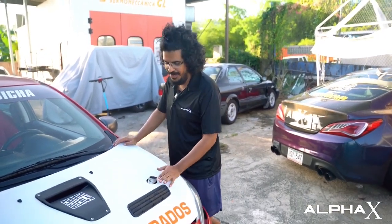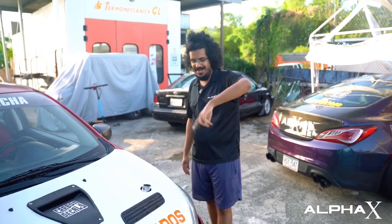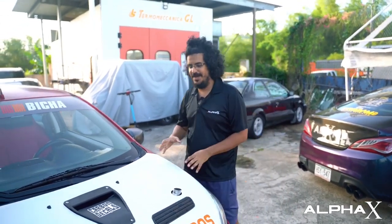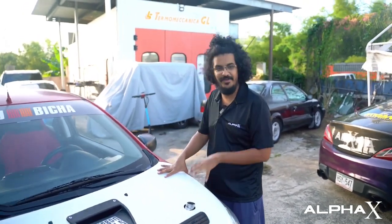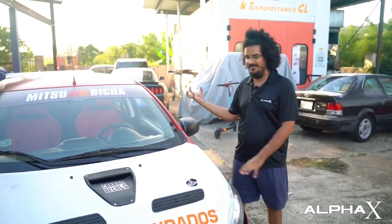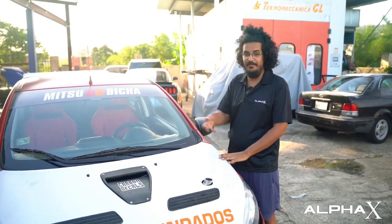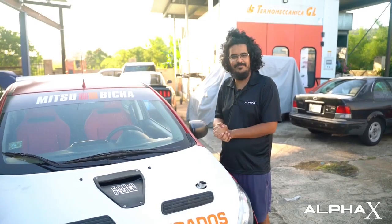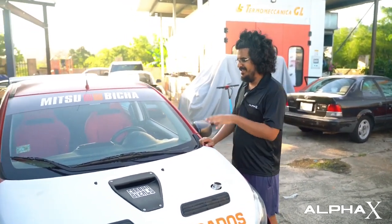Since we never found an aftermarket clutch solution, I did something I saw on a YouTube video about some guy who used a three-cylinder Mirage in his buggy — his name is DirtgearTV, I'll put a link in the description. We basically did a double diaphragm install. I bought a clutch kit on eBay with a pressure plate and clutch disc material. I told my buddies in the shop to take out the springs from one pressure plate and put them in the other, so we have two pressure plate springs clamping up on the clutch — a double diaphragm. That helped it a ton, and when we figured out the clutch wouldn't slip anymore, I got way more motivated with the project.